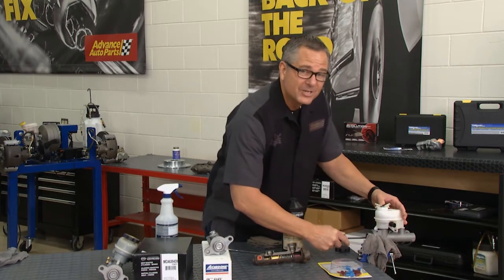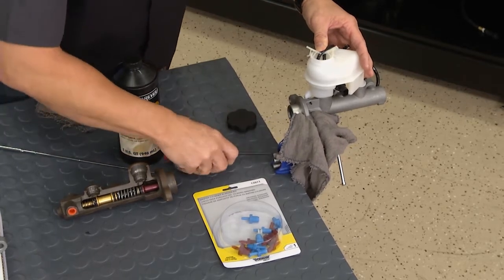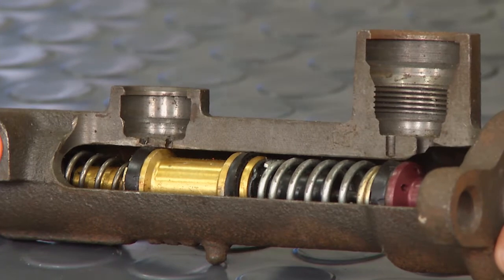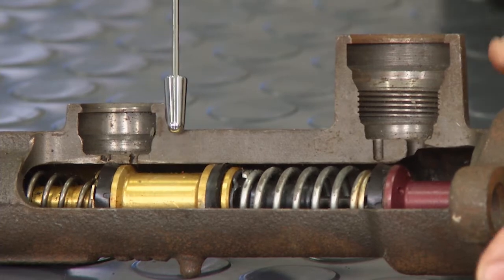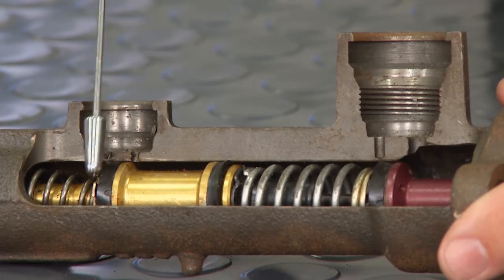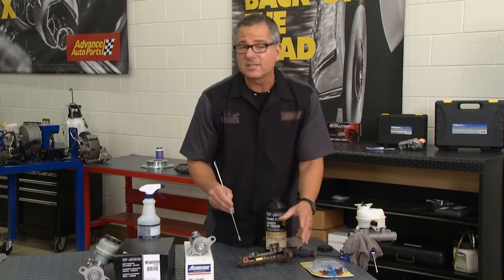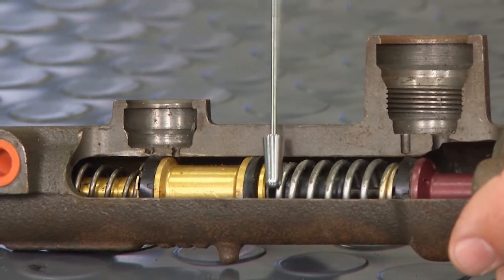You want to throw a couple of big strokes and some small ones. Remember earlier with that brake booster? It gave us a lot of driver assist. Once all the air bubbles are gone, it's pretty well bench bled. Inside the master cylinder, I have a cutaway right here — you can see it has a couple of pistons: a primary piston and a secondary piston. On those pistons you have seals — primary and secondary. This pressurizes two chambers, which is how you get the hydraulics and pressure down to the wheel brakes. As I pressurize it, I'm getting all the air out.